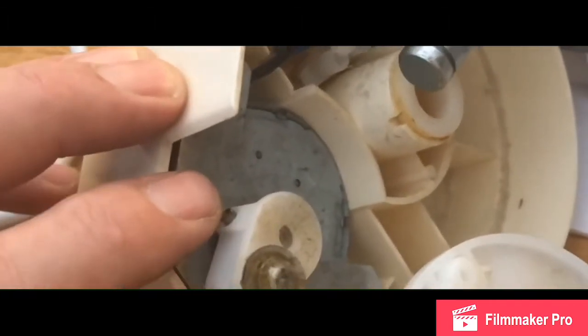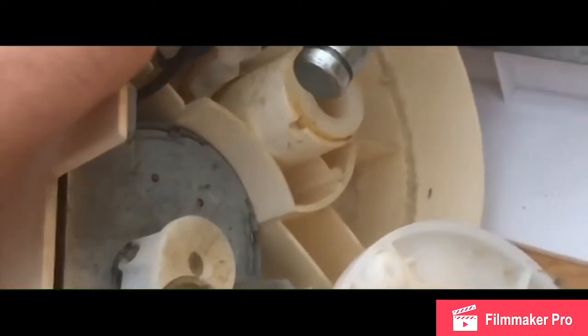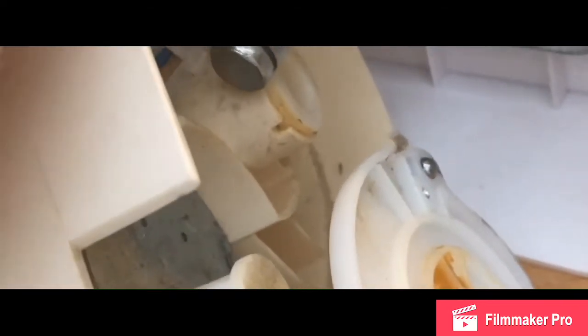After removing this off camera I discovered that I had a motor here, and a little bit of investigation led me to these wires, of which I gave a very gentle tug to this one and it came off. So this is the likely reason why the fan is no longer oscillating. I'm going to do a quick repair on this — I'll get the snips, take a bit off that, remove this connector here, and solder them together with a piece of heat shrink tubing. That should be electrically insulating and it should be a good repair. I've got the soldering iron already.